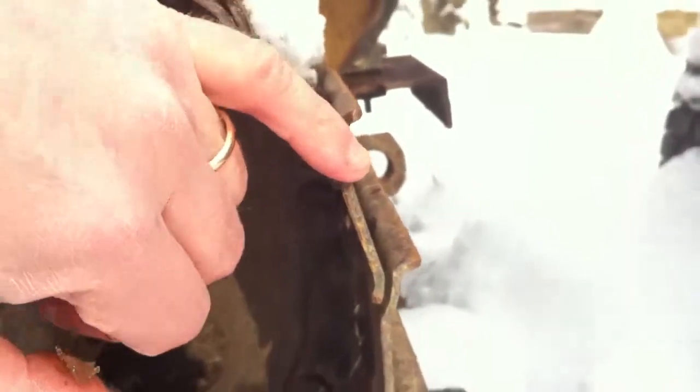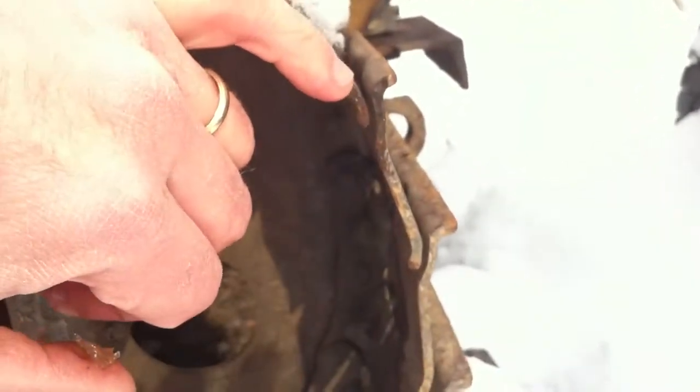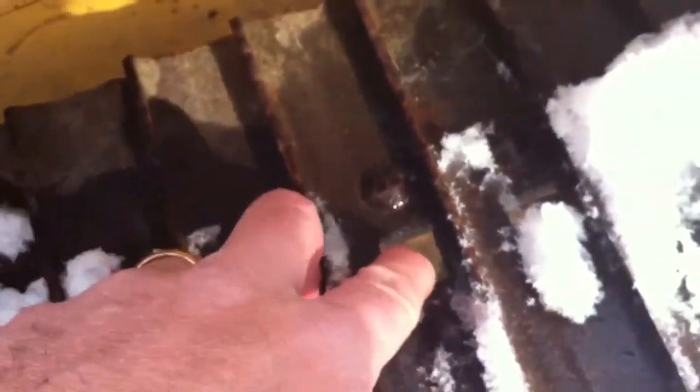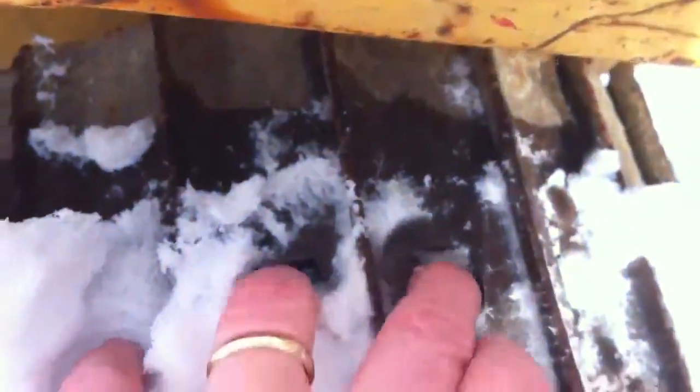So you really need to have this minute bend in here to make it overlap with the next one, and you have to have that little bend up in the front. And that's why Struck has that in the plans. Because even with the flat ones, they still have those bends in there. And they also have the relief holes, because if you don't have the relief holes, then where the sprocket pokes through, all the junk comes up through there and it knocks it off.